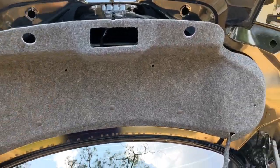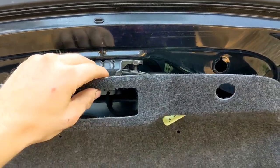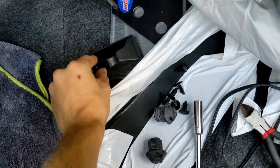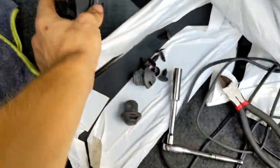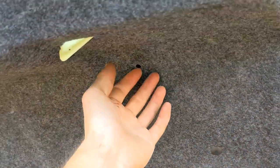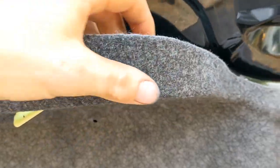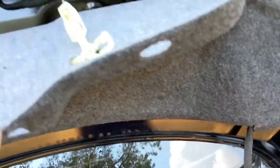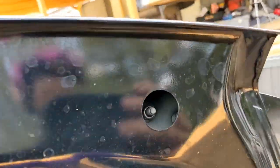To remove the spoiler, you just have to unscrew the two bumpers and then yank off this plastic piece right here. It's easier if it's sitting in the sun because it's kind of a squishy plastic. Then instead of using a pry tool to try to get those off — which breaks off the head sometimes — just lightly pull on the fabric and it just pulls the pins right out, so you don't have to have any tools. I'm not going to take it all the way down because I don't need to — you've got one there and there, and two on the ends.